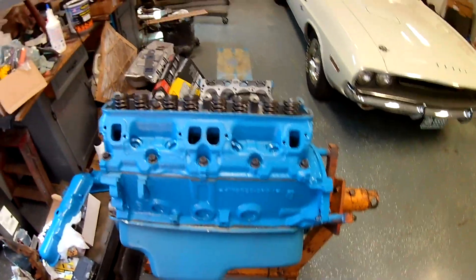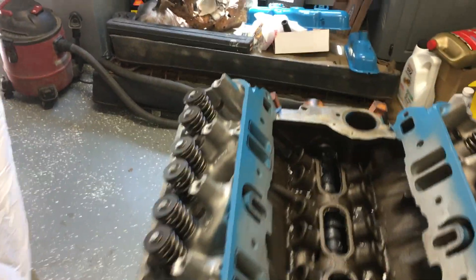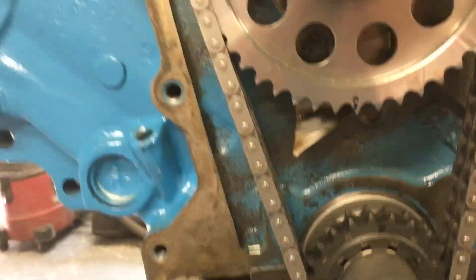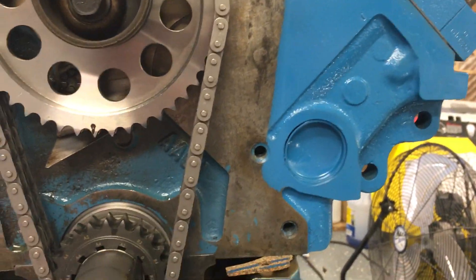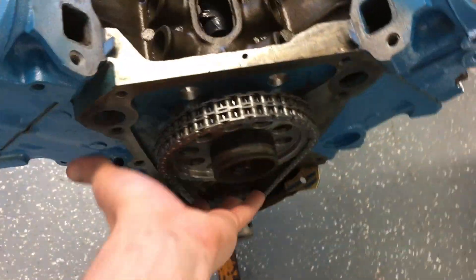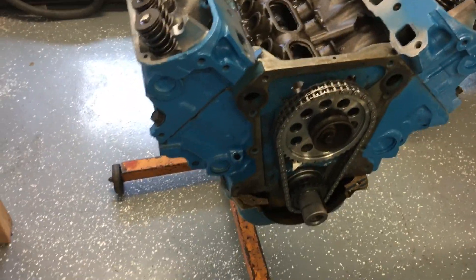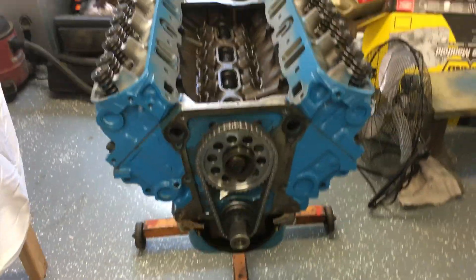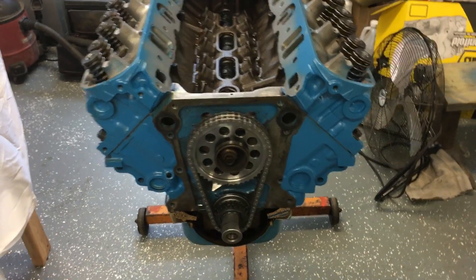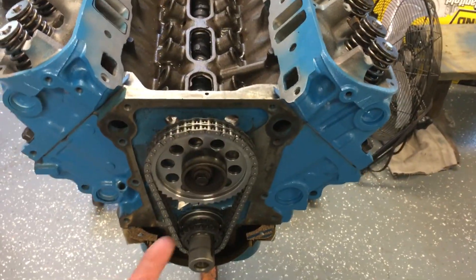I'm going to get her flipped over and do the other head. Not a bad day. Anyway, I wanted to talk to y'all about my new timing chain — finally got it in. Several comments about people wanting me to stick the front cover on before the oil pan, and I 100% agree with that — you are correct in every form and fashion. The reason I put mine on the way I did: I wanted to get this motor sealed up, and I only get to work on it certain days. So yes, tip: put your front cover on first and your life will be much easier.